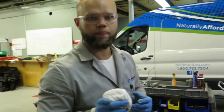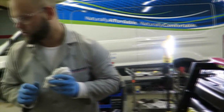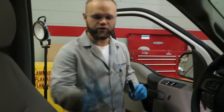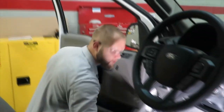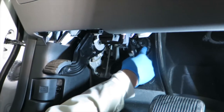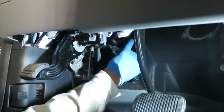Alright, we're going to do one more hole, which is going to be for our switch and a gauge harness, which I have right over here. We're going to drill a 7/8-inch hole through the firewall. I'm going to drill from the inside, so I need to set up my lighting and tools for this install. We're going to go over to where the harness runs from the firewall through this insulator right here — about an inch up and an inch over — and we're going to cut out this insulation.